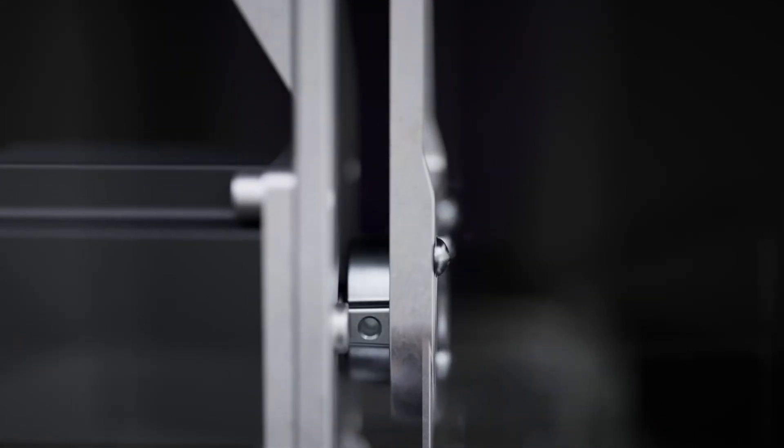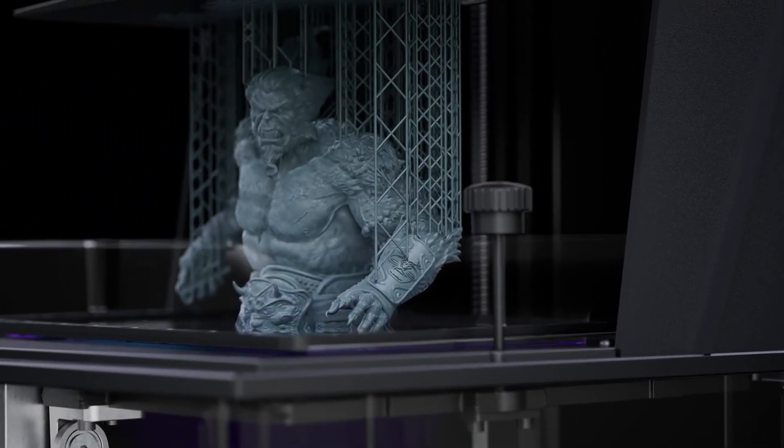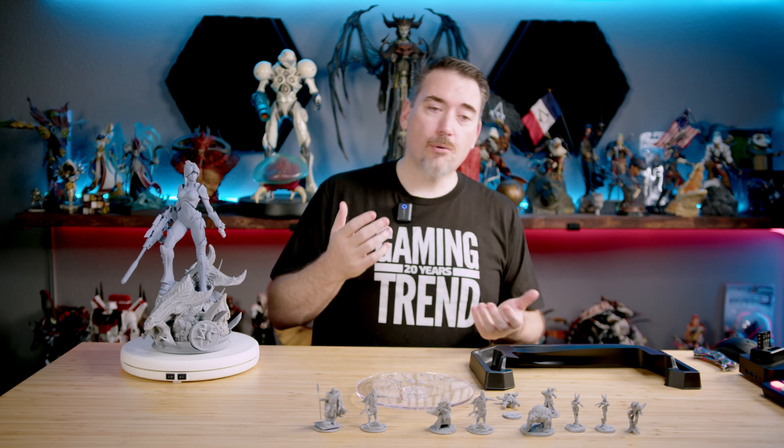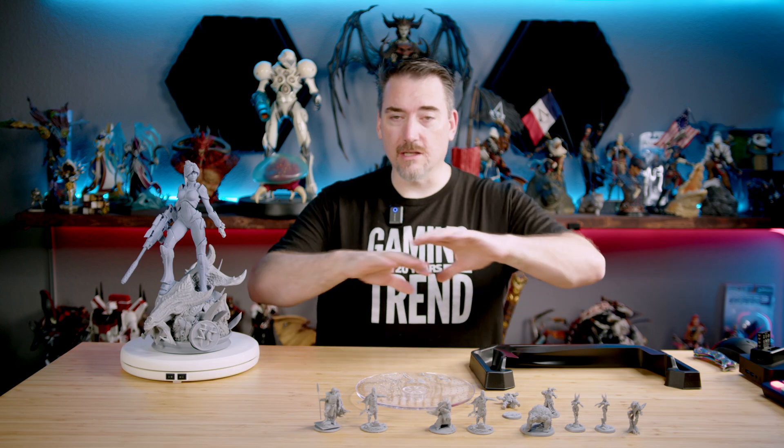The con here is really more of a concern than a drawback. The Saturn 4 Ultra has a moving part that the non-Ultra doesn't — that moving tray enables it to print twice as fast, and I was able to print the Nova in record time. But it does introduce a moving element, and that moving element does not have any sort of gasket around it. Because of that, when I inevitably have a puncture or spill, there's a very real risk that resin gets underneath and into the components. Combined with a one-year warranty, I'm very concerned. At $399 it's an astronomically low price, but I still don't want to spend $399 on my first resin spill. A gasket around that would be a great addition.